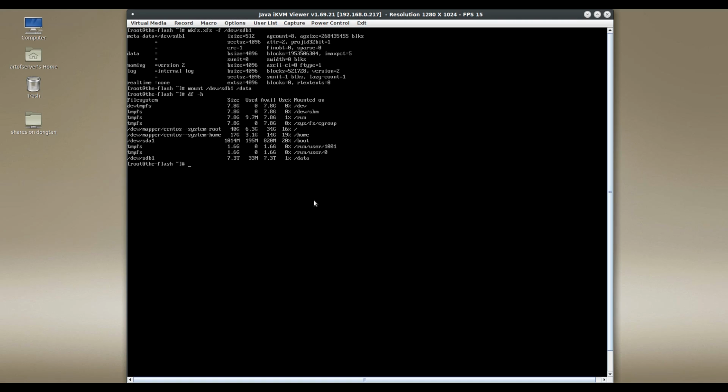Alright, so that concludes our last test, and basically the answer is, or if you skip the whole video, the critical thing to know is that all these controllers, from the SAS 2008, SAS 2308, SAS 3008, SAS 3408 LSI controllers, all seem to have the capability to support 4KN drives. Now with the caveat that I was using a particular model of a 4KN drive. That was the Hitachi SAS 4KN drive, 8 terabytes. So now you might have problems using other models.